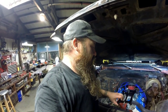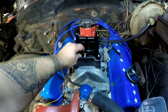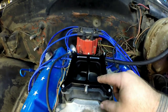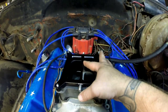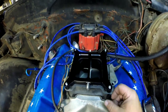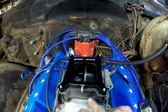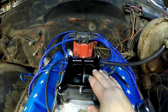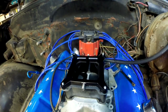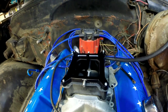So I'll have to make my own longer studs to be able to put this nitrous plate on. If I just put this nitrous plate right down without the spacer, that divider in the intake will get in the way of my spray bar. I've also thought about just putting a 1-inch spacer underneath and getting rid of the 2-inch, but I think I'm going to go with what I've got right here — make some longer studs and roll with it, whether it's exactly right or not.